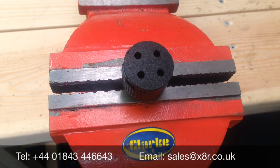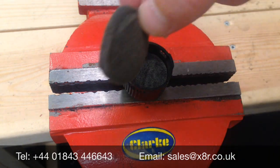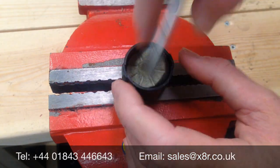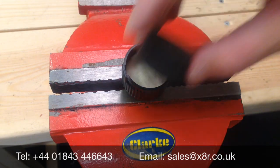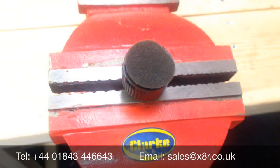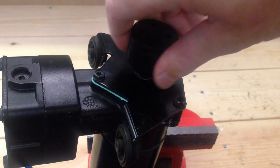For the full refit of the filter unit, clean the filter unit and remove the old filters. Lift off the lid — you can see the old filters in there. Lift those out. Insert the new filters — as you can see, that's how they should look. Reattach the cover and now refit the filter unit, screwing that back into place.